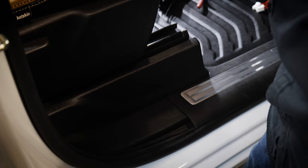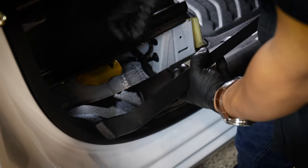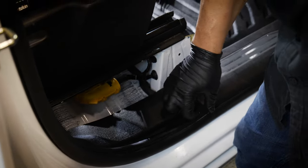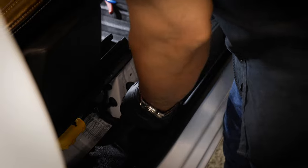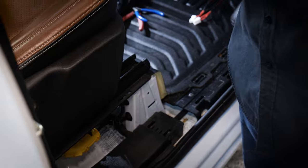Before we get the other wiring harness in here, what I'm going to do is pull the side moldings off. I'm going to start with the one by the seat — that just basically pulls straight up and out. You need to do that one first because the door sill on this side is overlapped by that piece. Pull up on there and pull to the rear on the kick panel and it should pop out. Now we should have plenty of access to run our main harness.